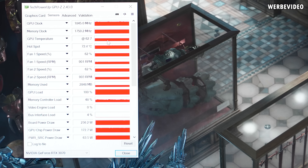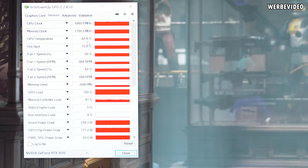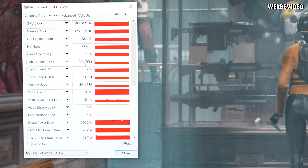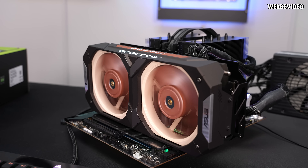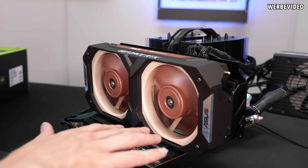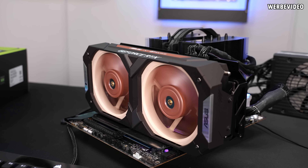There's actually a lot of headroom. If you allowed the card to have a higher GPU temperature target — maybe 70–75 degrees Celsius — and sacrificed another 30 MHz on the GPU clocks, you could probably run at 800 RPM. But since you can't hear it already, that probably doesn't make much sense. Now running gaming tests in Remnant from the Ashes at 1440p — still cannot hear anything from the fans, but I can definitely hear some coil whine on the card, simply because everything is so quiet.